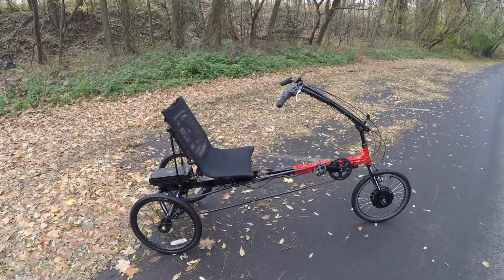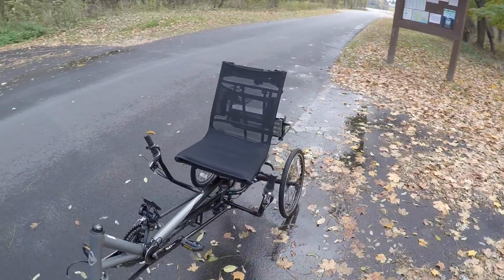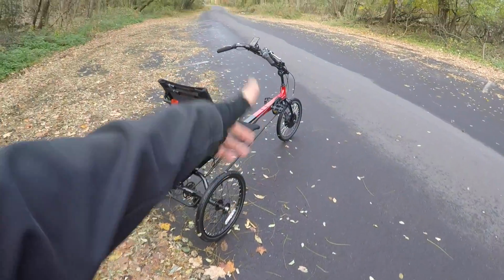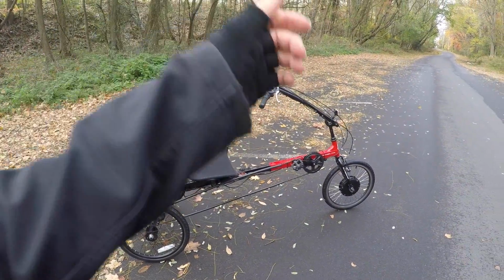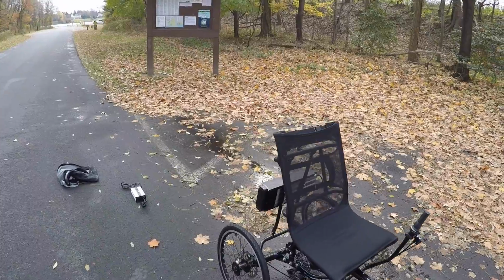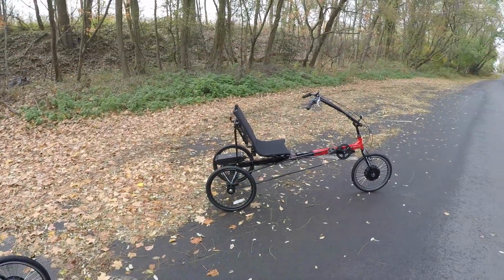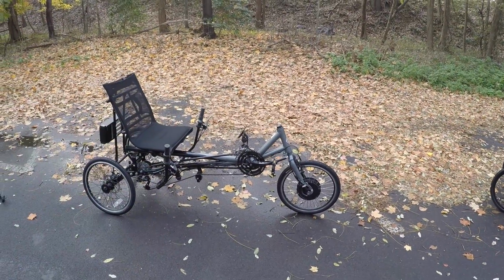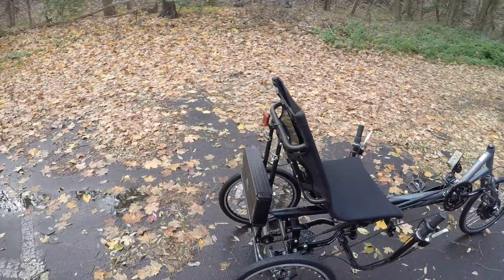This is the Eco Delta, and now we're looking at the Eurus. This thing is similar in the sense that you can see the seat is raised a little bit, and it's got two wheels in the back, one wheel up front. The difference being the handlebar setup, and that this one's 7-speed. It's a very similar motor, but a 36 volt 10 amp hour pack versus 48V 10. This one's going to offer about 45 Newton meters of torque versus closer to 21. This is a 20 mile per hour top speed versus 26 to 28, depending on who's riding and what the conditions are. This thing is phenomenal, and it's designed to be ridden a little bit faster.